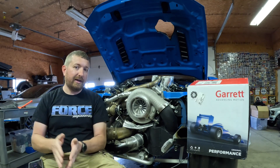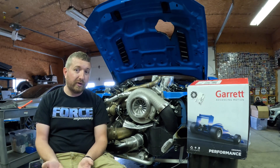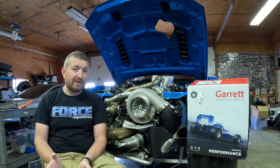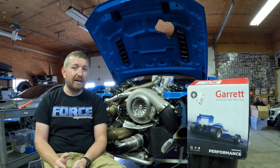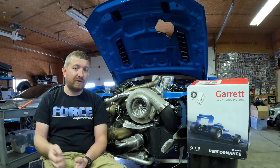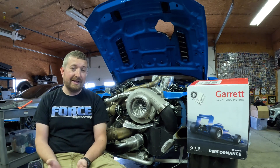There are lots of ways to skin the cat there. Don't ever approach turbocharger selection as 'I want to make X and it won't work' — you can make it work, it's just how much effort you're willing to put in. Be realistic: you're not going to make 3,000 horsepower with a 2 liter engine that only turns 8,000 RPM, and probably not 3,000 horsepower from a four-cylinder engine period. But there are guys trying with a compound turbocharged billet block SR20 to make that mark, and they're going to get there. The primary chargers don't care how big the engine is — they care about mass flow. Just don't be afraid to pick the charger to meet your power goals. Be aware you're going to have to put in the work to make the system work together, and sometimes that's extensive.